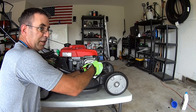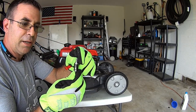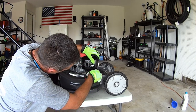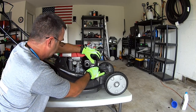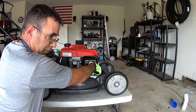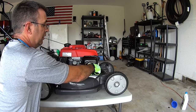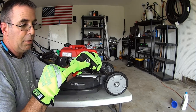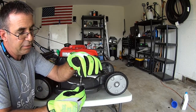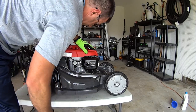We'll go ahead and put this back together — no torque specs, just tight. This is something the schedule says to check after about 100 hours. Pro tip: if you've got a bolt that's hard to start because it keeps falling out of the socket, put a dab of grease on the socket head, stick the bolt in there, and the grease will hold the bolt so you can go upside-down and drive it into the hole. You can even use Vaseline if you don't have grease.